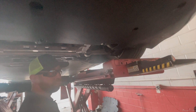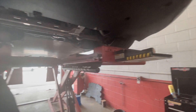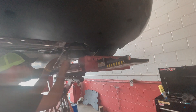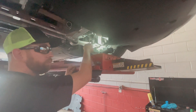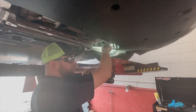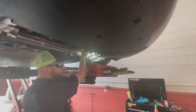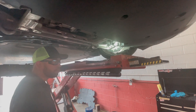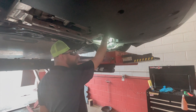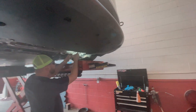So we're testing just for fun what the most negative camber you could run on the front stock suspension components. And where are we at? Negative 1.6 — that's maxed. Let's just run it at negative 1.6. And that number won't change much when you change caster. So the last part on the front: he's adjusting toe, and essentially anything you adjust will affect the other components to some degree. We're hoping we get the toe within spec without throwing off the caster and camber too much. As long as the steering wheel is being held, everything will go right where it should.